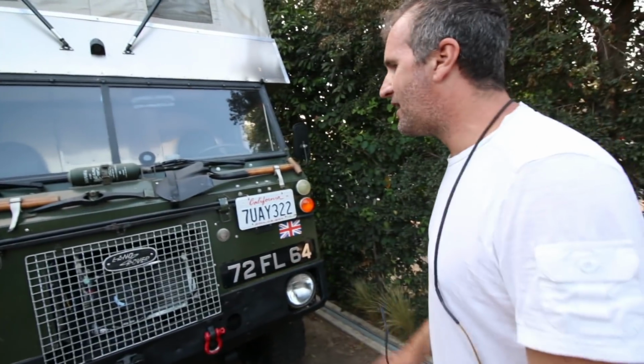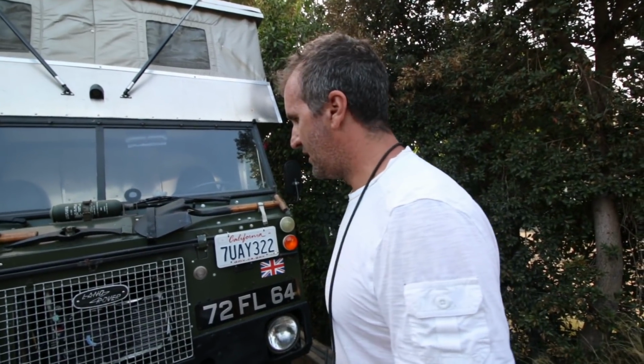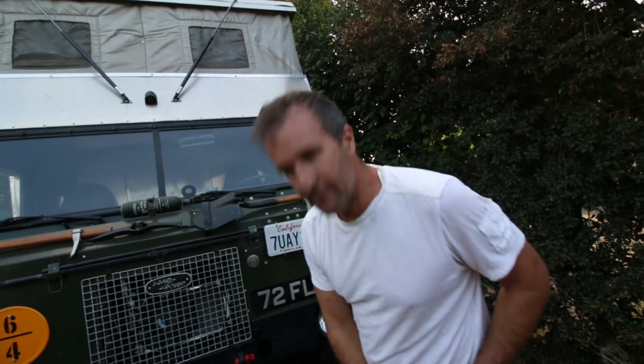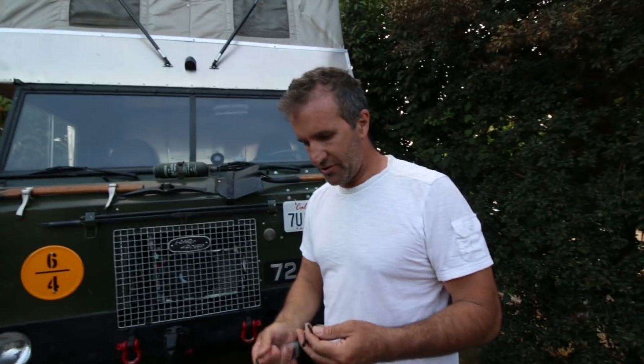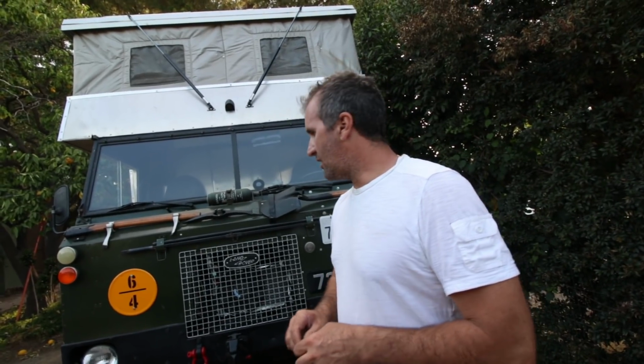So I put a new LS engine on it, from a 2010 Silverado, generation 4. I put AC. I put a 6-speed transmission, all from the same donor truck. And I put an LT230 transfer case from a Discovery 2 Land Rover. So they make an adapter. Yeah, and that's a common thing that people do to these.